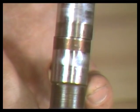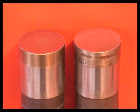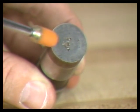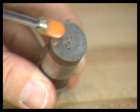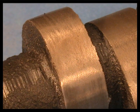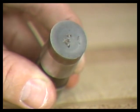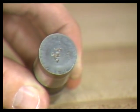The bottoms of new lifters are actually crowned or humped. Worn lifters like these will become concaved or dished. This would often mean that both the lifters and the camshaft should be replaced as a set. Lifter wear normally means equal or more cam lobe wear. This badly worn lifter would instantly tell you to order a new set of lifters and a camshaft.